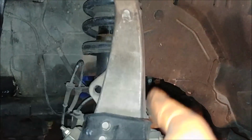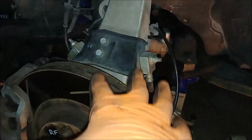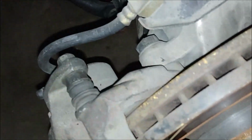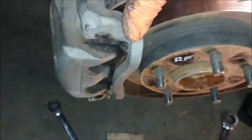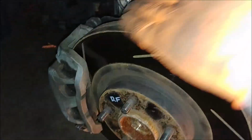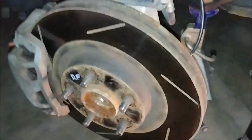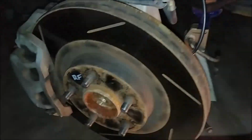This is going to be a really heavy assembly. Remember, we're going to remove the bottom too. So this assembly is going to be very, very heavy. What I'm going to do for this is actually remove the brake caliper bolts, the brake bracket bolts. These two big guys over here, the 22mm, that hold the bracket onto the hub and the caliper onto the bracket and in turn the rotor. And you'll see what I do.